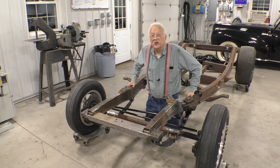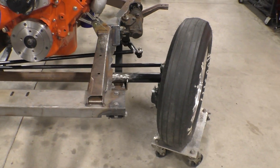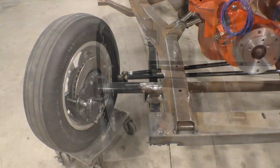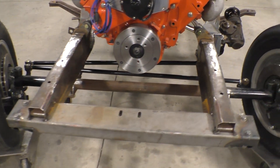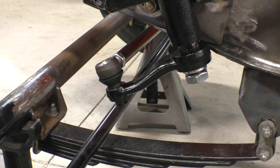Let's put some weight in here and see what it looks like. If we turn the wheels all the way to the right, we have clearance everywhere. If we turn the wheels to the left, we have clearance everywhere. Let's talk about the pitman arm. This is not the stock pitman arm from a 1965 C10 pickup truck — it is a pitman arm from a 1964 full-size or 1968 to '72 mid-size GM vehicle. It's Speedway part number 91032557.